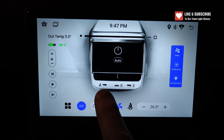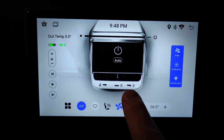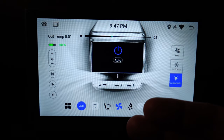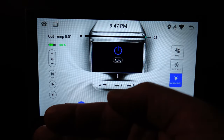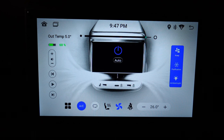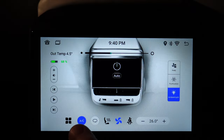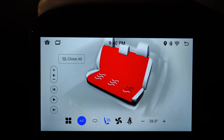Back at the control panel, we can see the USB options. The first is for uploading multimedia files, and the remaining two are power only — they are USB-C as well as USB-A. Whilst the angles of the air vents are fixed, one of the nice features of the air conditioning controls is the ability to control both the rate of flow and the temperature. We can feel that the airflow at 40% is definitely not being restricted by the smaller vents, and using the slider to increase the speed, it's certainly blasting through as much as the factory fitted unit. We have some of the same functions as the front screen for keeping the AC going on exit, the biohazard settings, and being able to turn the ambient lighting on and off. From the bottom icons, we can turn the AC on and off, circulate the air within the cabin, and now we can control the rear heated seats — turn on each seat individually, adjust the temperature, or just turn them off completely.